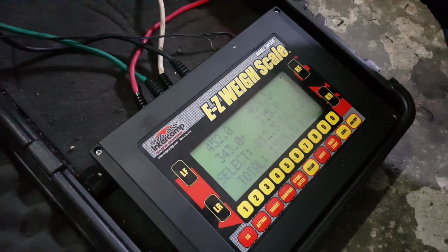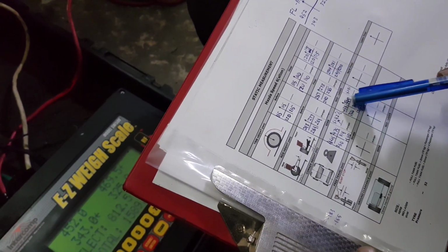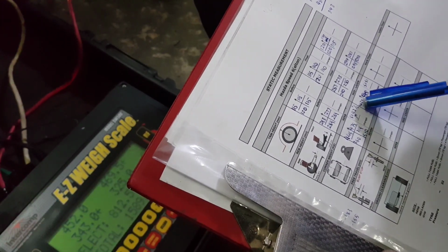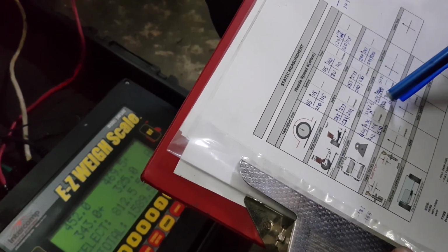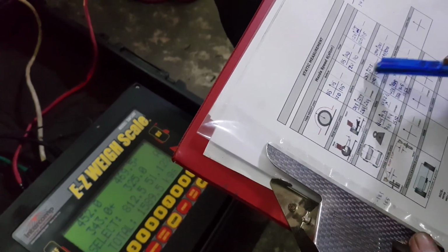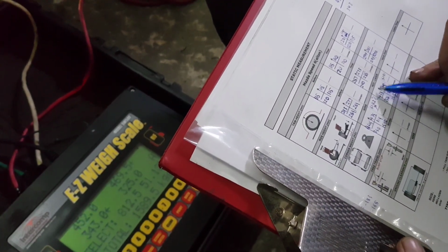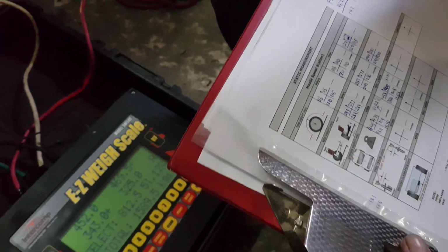Front left again. Yep, one more time, because judging from the data, when you see with you in the car, here's at 500, here's at 458. Still a bit of a large difference. If we were in a race car, for example, this difference would be very bad. It would pull the car towards one side even under braking. If you're very specific about corner weighting, per specific corner on per axle, in race cars, a 5 kilo difference between each side, or even sometimes 2 kilos, could throw off the levelness of the braking.